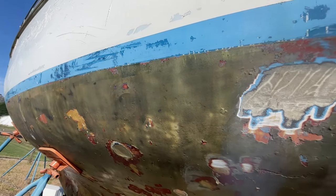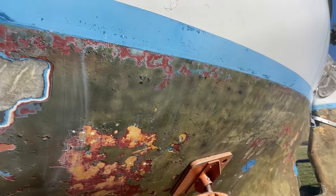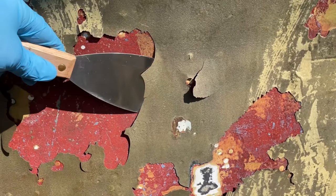We need to, of course, scrape the boat. A lot of the ablative paint is still peeling off. So scrape the boat, wash the boat, fair it in areas where we don't need the glass, fiberglass areas where we need fiberglass, and it's pretty much leaving it alone. I think structurally, there's nothing wrong with the boat. Those were the biggest concerns, and we're gonna fix them. We're just gonna put everything on time lapse. We got a lot to get done, but thanks for watching, and make sure you subscribe.